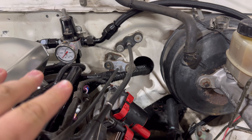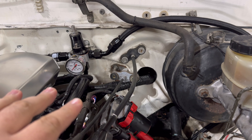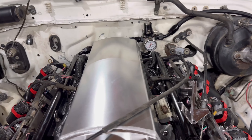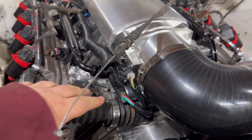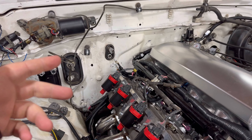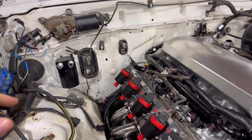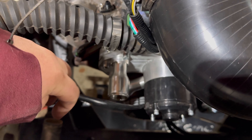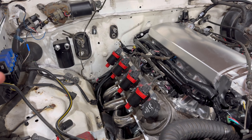We've been working on the wiring — we'll put a link to this harness in the description. We went through some minor bugs with it, but the harness is working out. We drilled a two-inch hole and ran the harness through. Everything's pretty much hooked up as far as injectors and coils go, with throttle position and those sensors hooked up. Really we're just talking about oil temp, coolant temp, O2s — that's all kind of in the back. Then just grounds and the fuel pump stuff, and hooking up the fan, which we have set up to go. Wiring is relatively simple so far.